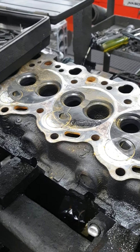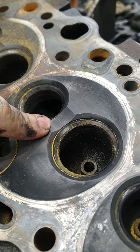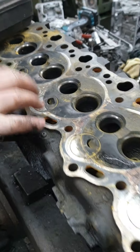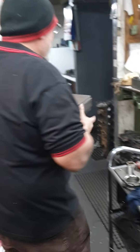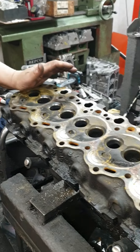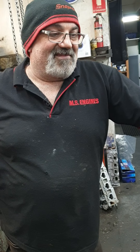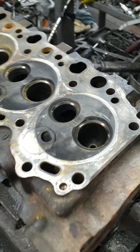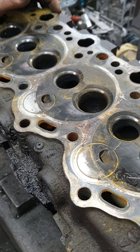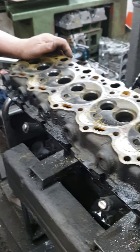But the problem with this head is: I've got that crack that's come up. Tomorrow this is going to crack here, then crack across here, then later on there. So you're going to be chasing your tail. So you do not fix this — this goes in the bin. I would not put it on my car, and I suggest people not to do that. If it's something rare that you can't buy, you fix it. But this — you can buy a brand new one. So we're not going to waste our time. I haven't even washed the head. Imagine if I washed it, how many more cracks would come up.